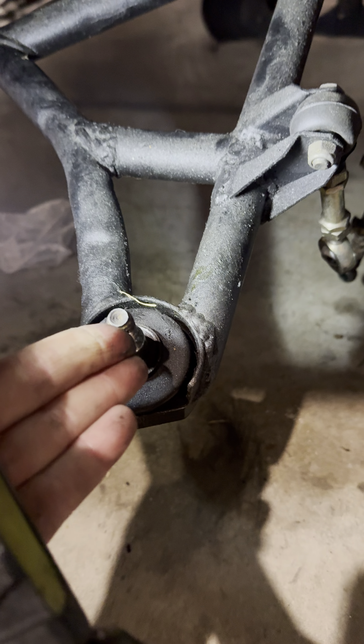I did go ahead and convert the car to two-wheel drive. I've still got to pull this front diff out. I removed the center drive shaft and everything else. The reason I did a two-wheel drive conversion is because I'm actually planning on driving it — it's a dream car. It saves on the clutch and the front tires. This car binds really, really hard when you turn since it's all-wheel drive. I've kept all the original parts, so if anybody ever wants to convert it back to four-wheel drive you absolutely can — I've saved every nut and bolt. It's actually really easy to convert; all I had to order was the studs that go in here, about $1,300 for the two-wheel drive conversion.